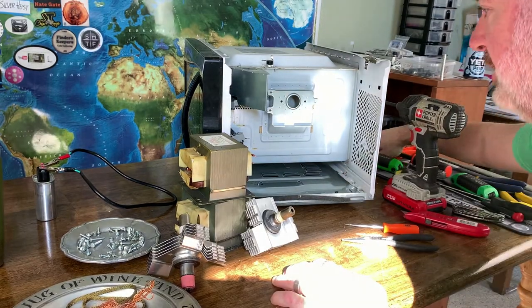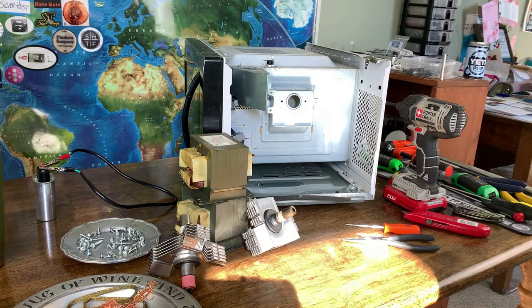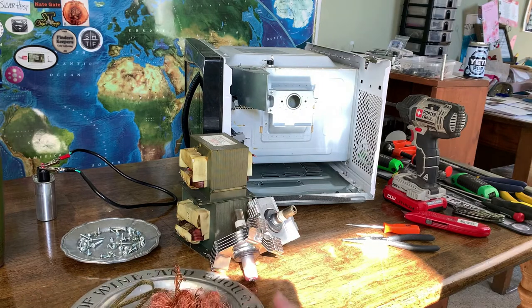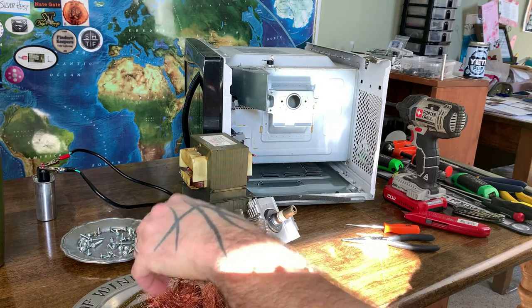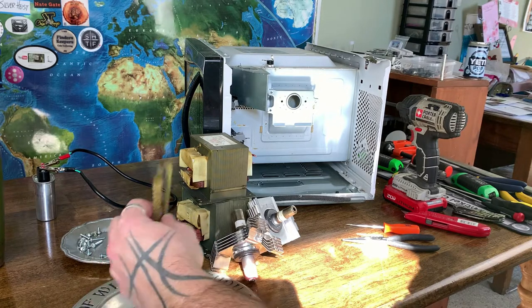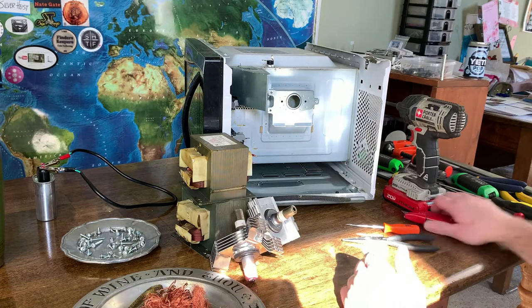Okay, I think what we need to do now is just go down to the workshop, cut these open, press these off, clean up all of these cords and whatnot, and get them in a bucket or something, and melt all this stuff down. I think what I'm going to do is make it into an alloy. Let's just melt the aluminum, copper, and this little bit of bronze, brass, together, and we'll pour it all into one bar. How about that?